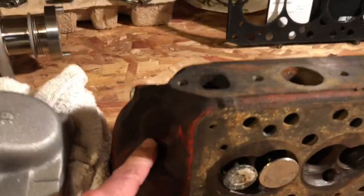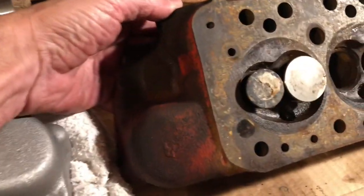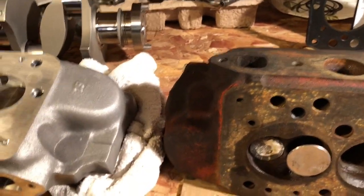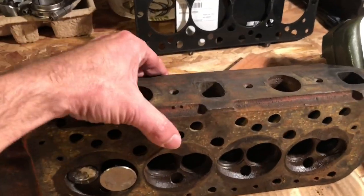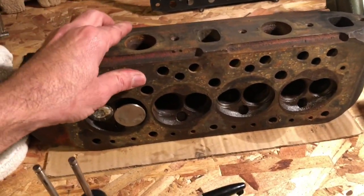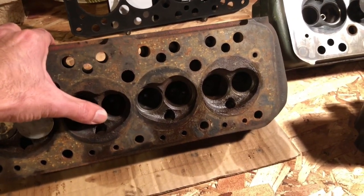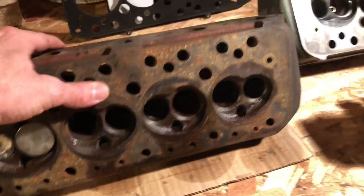The other one here is a 12G 940, one of the later ones. I like finding these for building race heads — this is going to be a core for one of our Series 6, the six-millimeter valve variety that MED does. You can see there's no water fitting here. I find the early ones tedious; the thread is weird. The later ones generally haven't been hacked on as much. This is full thickness, which we want — I don't want a tiny combustion chamber. I like about 24cc chambers with my flat-top pistons.